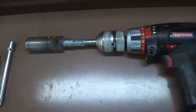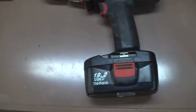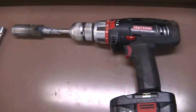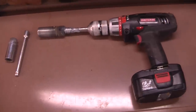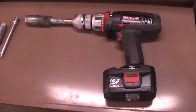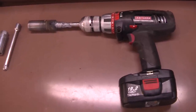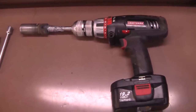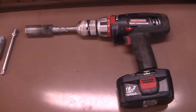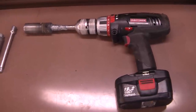Let's go ahead and start some engines with this. Make sure your drill is at least 18 volts, because it does require quite a bit of cranking power, especially if the engine is cold. A safe range to use this kind of stuff is up to about seven horsepower, because anything over that the engine starts to get really torquey and it can jerk the drill right out of your hands. So you just have to be careful and use discernment with this.